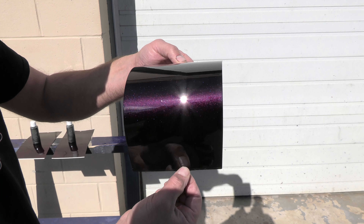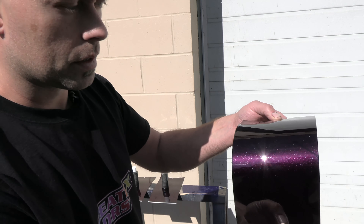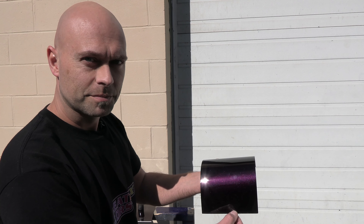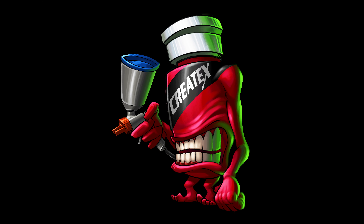It's really important to build these colors up in layers so you can control the depth of color. Because this color is very dark, you want to have that control. Without pigment — it's just the Cosmics giving you a little bit of color — and being a mini-flake, it really doesn't give you coverage in terms of hiding blotchiness or streakiness. So it's imperative to build this up in light coats, make sure they are thoroughly dry in between, and if you think it's good, maybe wait another minute — it's not going to hurt.